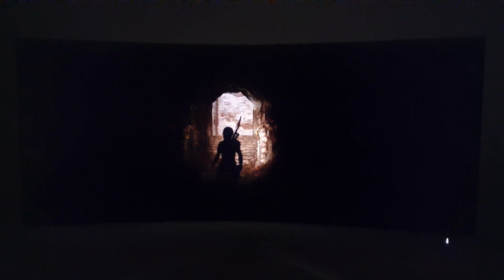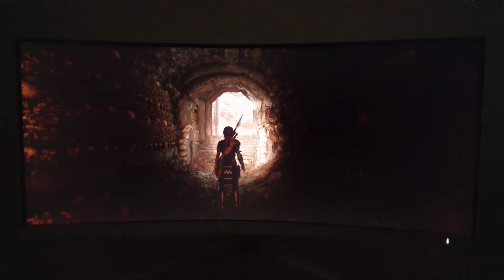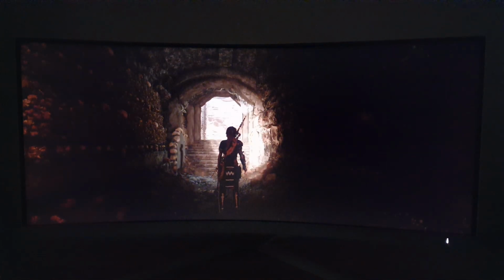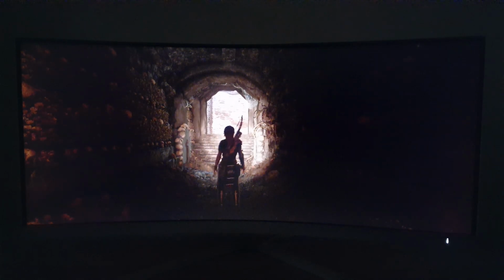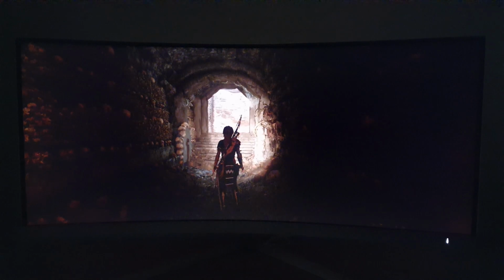And even if I look at some of the areas centrally illuminated by the torch, such as the skulls there just at the edge of the torch-lit area, they're also too dim. So it really is just dark biasing far too heavily here. I wouldn't expect things to look perfect here, but I'm just going to show you something. If I turn on movie, you'll be able to see these bones I was talking about revealed, but unfortunately things look completely flooded, as I mentioned before, with this setting, so it isn't a good compromise. Really, things should look somewhere between this and what I was showing you with the DisplayHDR 1400 setting. Again, I wouldn't expect perfection here because you don't get per pixel illumination.